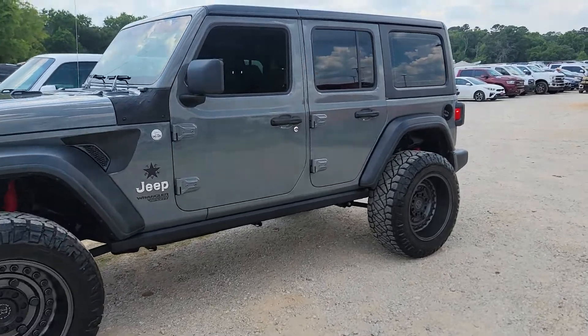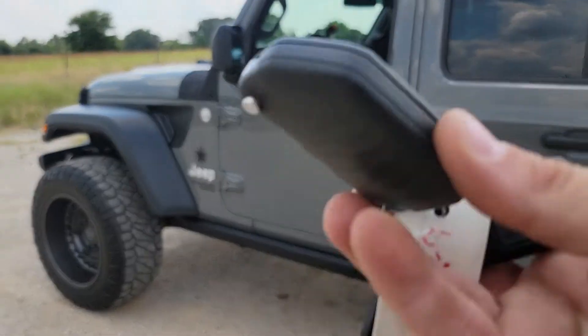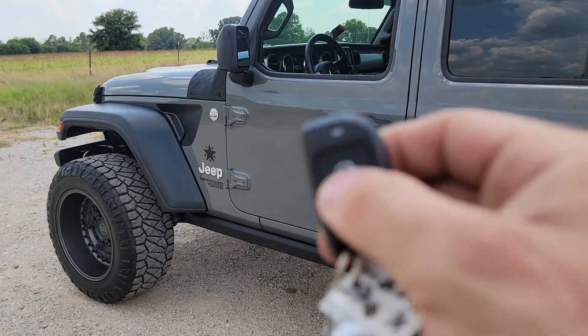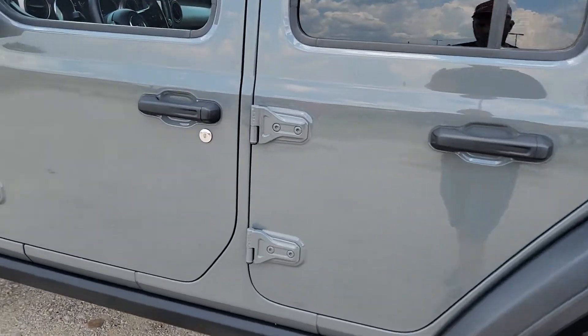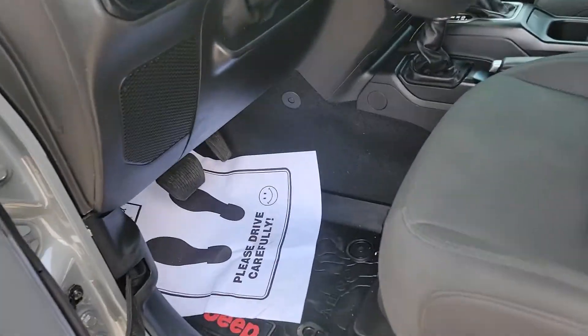We have this set on cool. Now when you're ready to get in your Jeep, you cannot just push the unlock button — this system arms the factory alarm. So you have to tap it one more time, and you'll notice the lights flash at you one time. This disables the factory security.